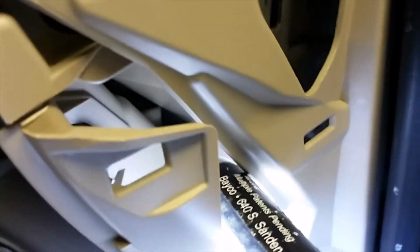let me see if I can get the light in here. There's a couple of clips you have to, well, actually one. There was only one clip. I think you can see it like this. There it is. See where the light's aimed right there? The tip of the light looks like 2 rails. If you slide a screwdriver in between those rails, see how they engage in the plastic? There's a little metal clip in between those rails. You push down that clip and that guy releases.